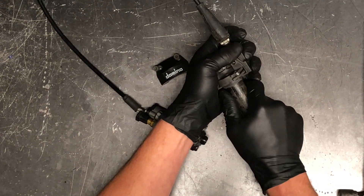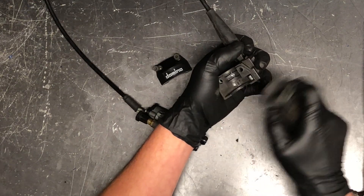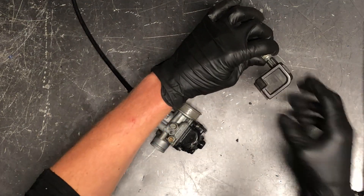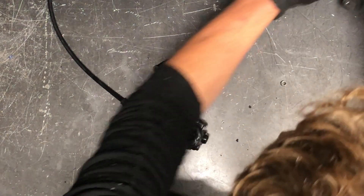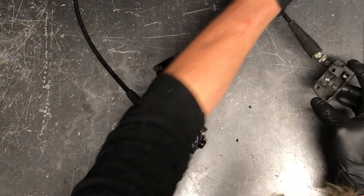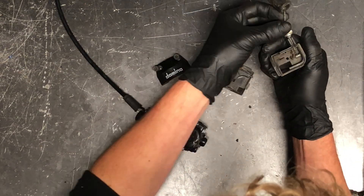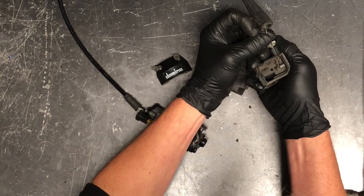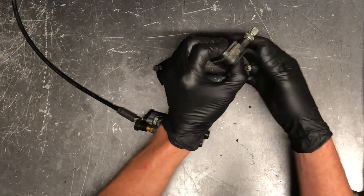Now the next thing — I like to twist it and then you want to get your throttle cable into that groove there, so you can just kind of pull on it and it'll pull right out of that throttle tube. Then you're able to set that throttle tube aside. Take and pull this cap up and you'll be able to see your throttle cable right there. Line up these grooves here and you're able to just slide that throttle cable out of this housing — your housing is now off and your cable is now out.